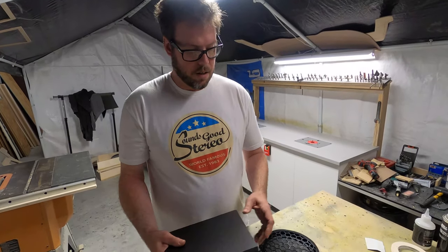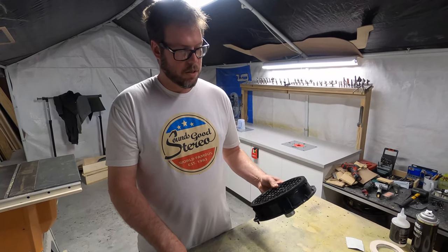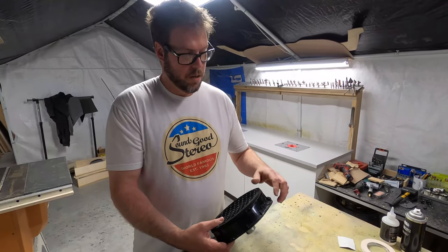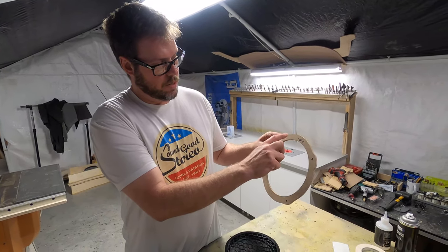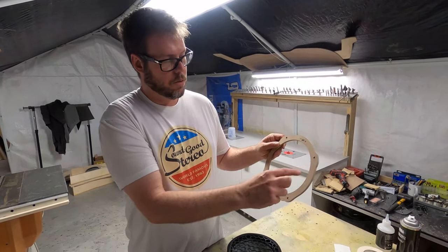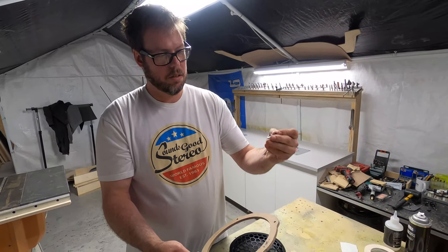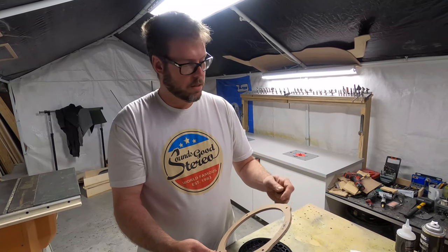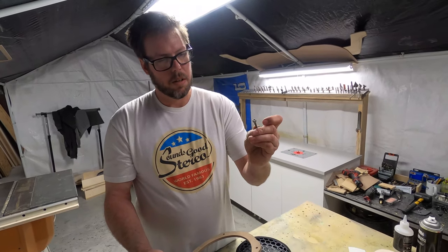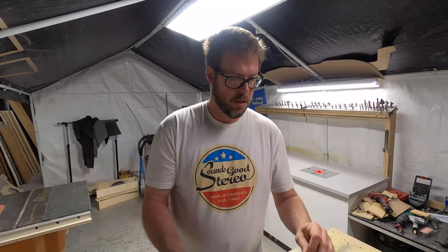So we're going to stack this up. We're going to actually countersink the woofer back down into this location a little bit. And I have to do some trickery because when the Utopia driver sits in here, it covers the hardware hole. I use a 3/8 countersink. It helps me drill down into the plastic so I can put my new hardware that I picked out. It's an M5, about an inch and a quarter long, that's going to bolt back into the factory location.